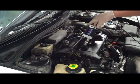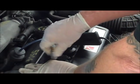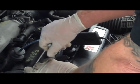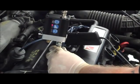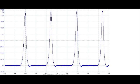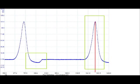It can also be used to monitor the pressure in a running cylinder and is becoming a valuable diagnostic method. Often you'll have identified a possible problem cylinder by using one of the previous tests, so you may want to only test the suspect cylinder and one known good one to use as a baseline. This is what a healthy cranking compression pattern looks like using the transducer in the cylinder. Actual pressure can be recorded by the peak pressure reached — that's all the mechanical gauge would have told you. Notice the small dip, which is the exhaust pocket, and how the peak is symmetrical in this known good cylinder. Here's a bad cylinder: peak compression is lower than it should be, the exhaust pocket dips much deeper, and the peak is not symmetrical — obviously different from the known good baseline pattern.